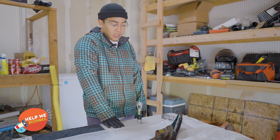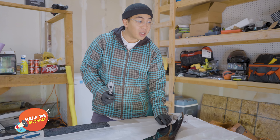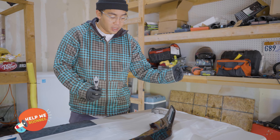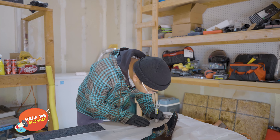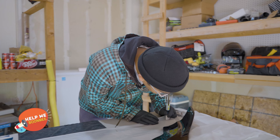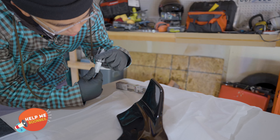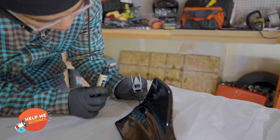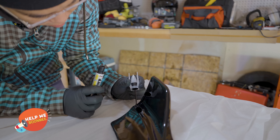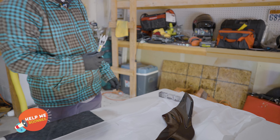I painted it, used my heat gun to dry it off a little bit quicker, and then put the clear coat on. Another point is that this area is going to be basically underneath the bumper. The only reason I'm doing that is just so that water doesn't get in there and pull up the paint from normal weather. In this spot it's important — I should put a heavy coat on there.